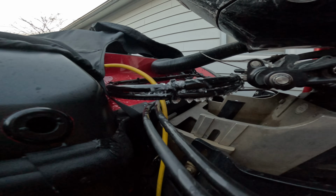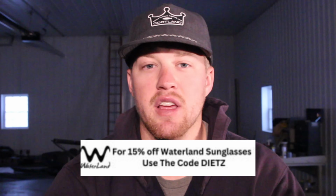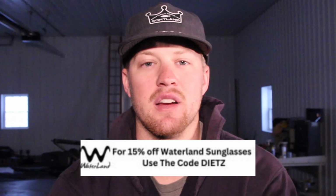Now, I don't care if you just drove somewhere and your batteries were plugged in the entire time before you got there. If you get where you're going and you have time, make sure your batteries are plugged in, because this is going to keep them warm and keep them charged. Cold weather will suck the life out of your batteries, especially if they sit for an extended period of time below 32 degrees. It can really wreak havoc on them if you don't have them plugged in. So I always try to keep my batteries plugged in as long as physically possible before I get out there on the water.